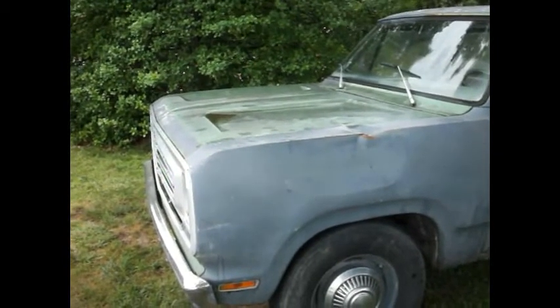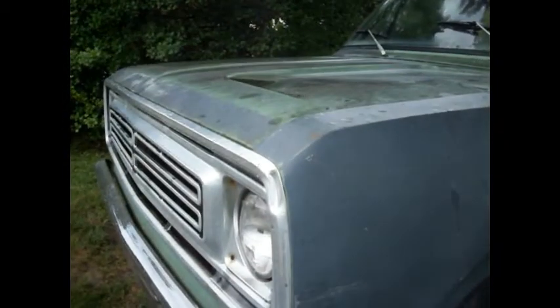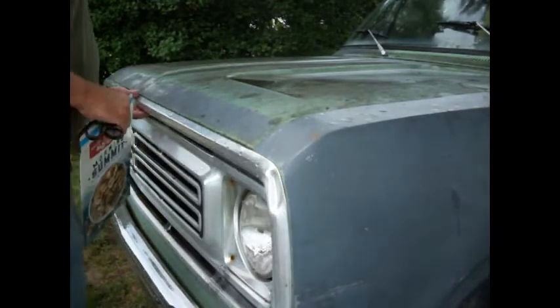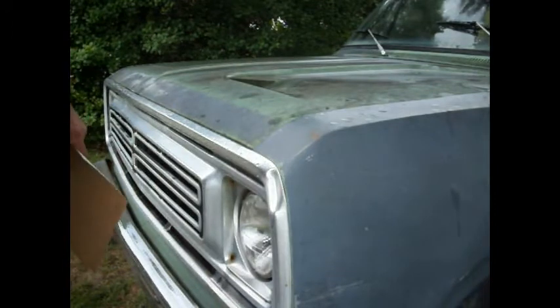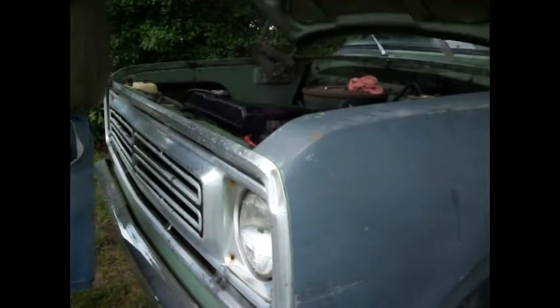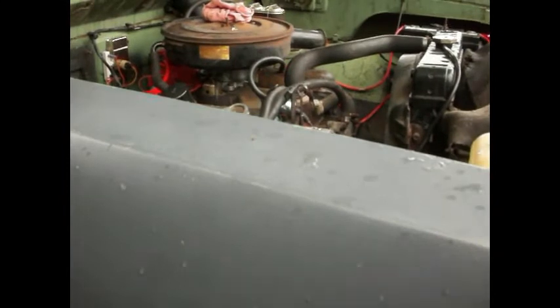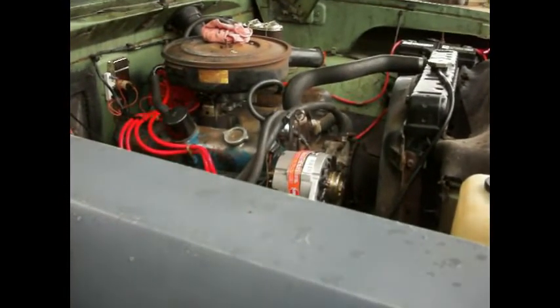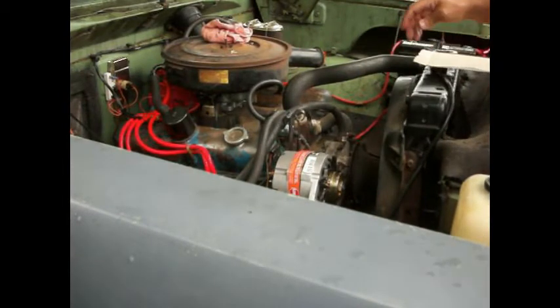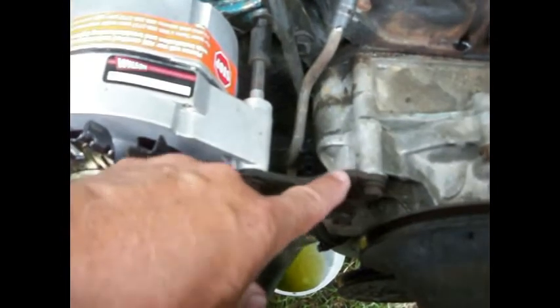These Dodges, in my opinion, have crappy charging systems. So what we're going to do today is take this charging system and convert it over to a one-wire Wilson - or as Vice Grip Garage would call it, a 'whirly thing.' You can see here is the new alternator; I've got it sitting on there, we're kind of mocking it up. We had to bend this bracket actually opposite, because Chrysler alternators are thin, so this bracket actually bent back like this.